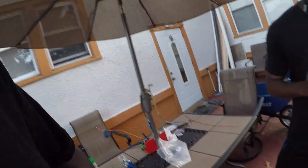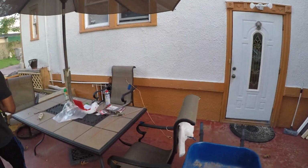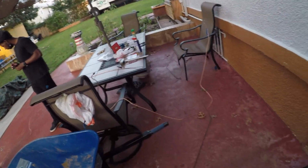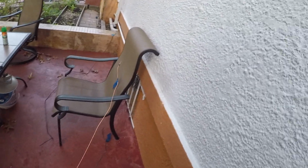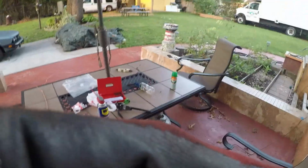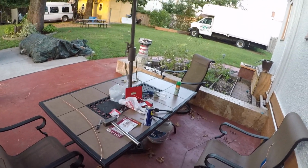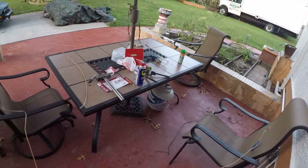But like I said to my pops, and to my brother and everybody else, if this doesn't work, and when I tighten up everything it still leaks and doesn't hold pressure, I will start again. I'll either keep this same line, cut off this tip here, get the bubble flare kit and do it, or if the line is no good because I didn't leave enough slack, then this material is not that expensive for me to buy another set.